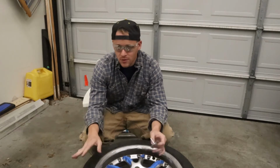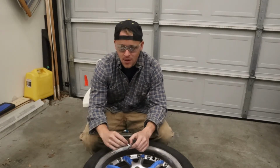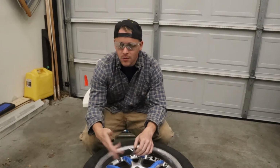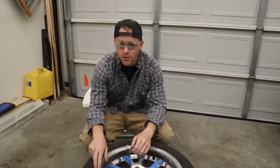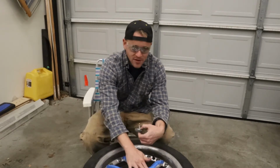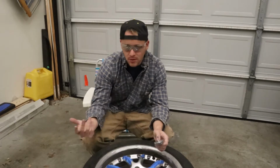And then once I get all the corrosion off, I can start smoothing the surfaces with the sandpaper from 200 all the way up to 3200, and then wet sanding and polishing. And then hopefully that'll be it for the aluminum. And then after inspecting these wheels, I'm definitely going to have to paint the center caps, so I'll look at doing that at a later date.